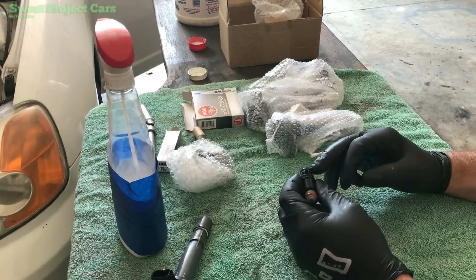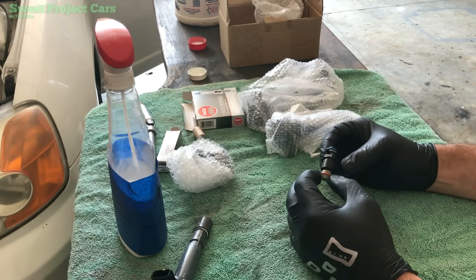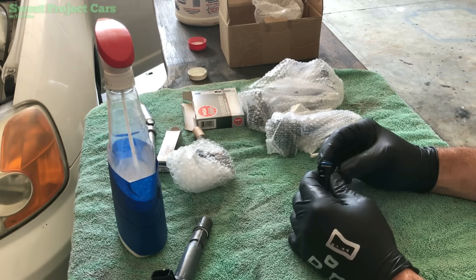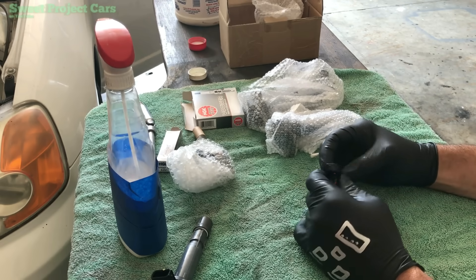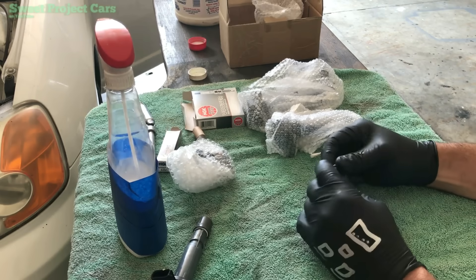You can take these off if you have older injectors and they're still good — soak the seals in 303 for 20 to 30 minutes, set it out in the sun, and let it warm up good on them. But these are brand new, so we're just going to coat them.